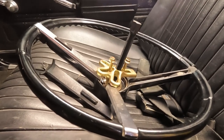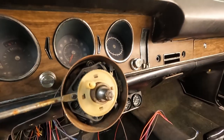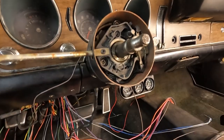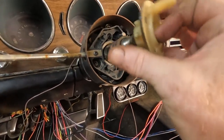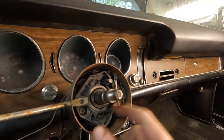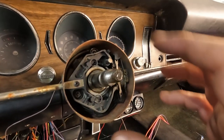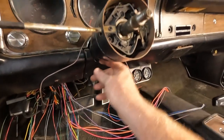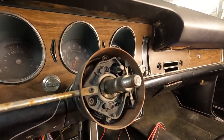I popped my cap off and made sure I knew where to put it back with tape so I can line it back up. The horn is a little more complicated in this car — there's a separate wire that runs up to each one of these buttons, which is probably why they did what they did before. I'm going to have a whole new setup of wiring in here with the new switch, and then the horn wiring should be correct. I used a steering wheel puller to get the steering wheel off — there are lots of videos out there on pulling a steering wheel. This one wasn't terribly hard. After I took the center nut off, I just put the steering wheel puller on and pulled it off. This is the turn signal cancelling unit — there's a little spring in here, and it just comes out along with the spring. Then this is my turn signal switch — I think there are three screws holding it in.